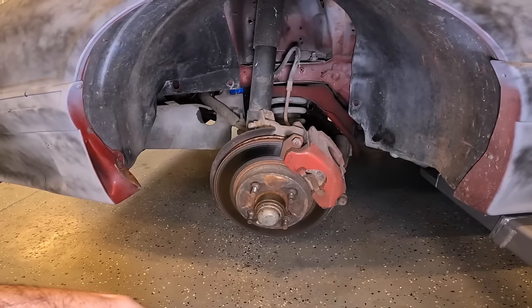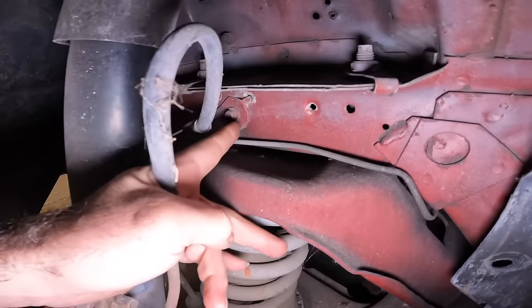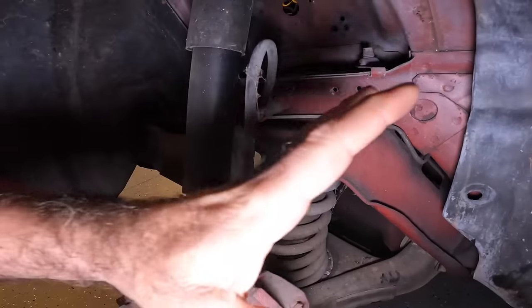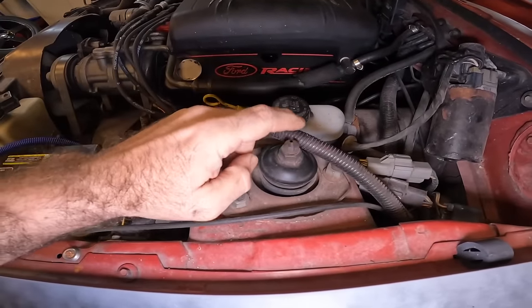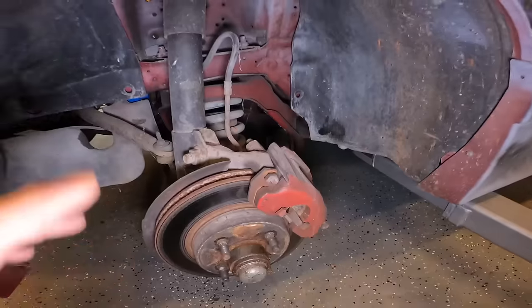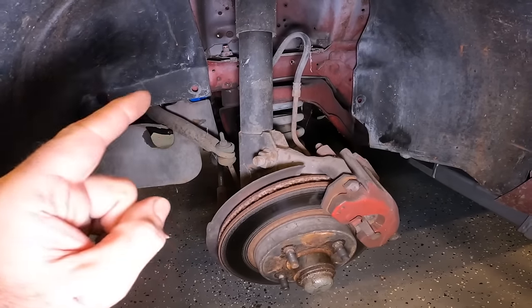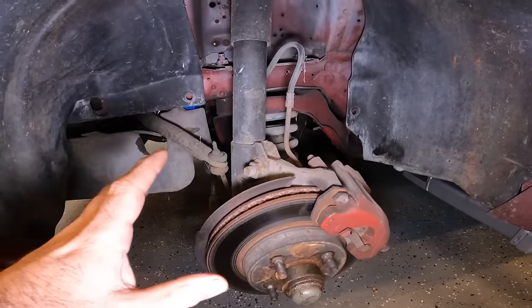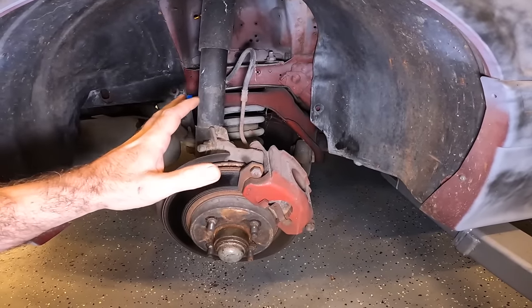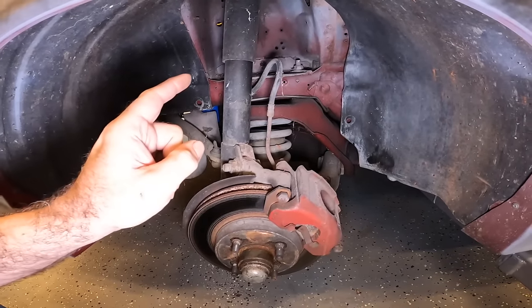We're going to keep this very, very simple. What we're going to do is take this brake line bracket off right here — I think it's a 10-millimeter bolt — and just let the brake line lay over here. Then we're going to come up here and take the top nut off the strut. The only thing left to do is take the sway bar off just right here up top. Everything is going to fall down far enough for you to get your factory spring out and put a cut spring or an aftermarket lowering spring back in. I will warn you ahead of time: if you're trying to put stock height springs back in with isolators, you need a spring compressor. Can it be done? Yes. Is it a bitch? Absolutely.